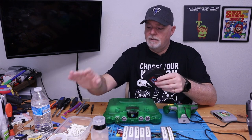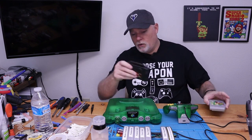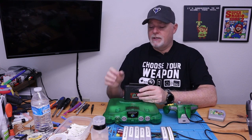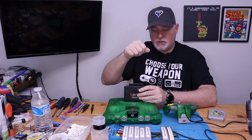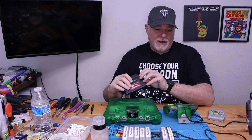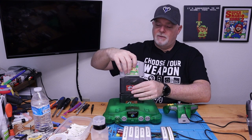I know I have seen countless people saying they've tried this and tried that. Honestly, clean the cartridge very well, make sure your console is clean, make sure all your games are clean. Then one by one, try different games. Don't just give up after popping it in and trying it once — pull it out, make sure it's straight, push it back in. Sometimes you just get a bad connection because these are fiddly. Since both of these are working and both are on Mario, I'll show you the stack method and why it doesn't work on these ones.